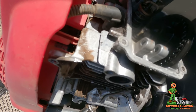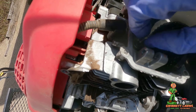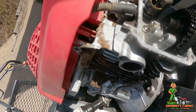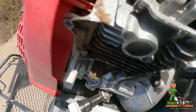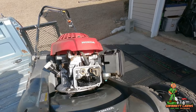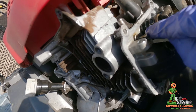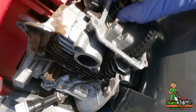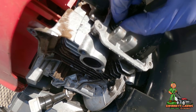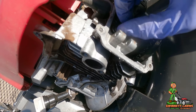Make sure the engine is at top dead center, because if the piston is at the bottom of the cylinder the valve could fall down in there. That's pretty good right there. I'm just going to have to make this part of my routine. I've heard there is a fix where you can take the intake umbrella seal and put it on this one and it will prevent it from coming out, but I'm not sure about that. It's just a bad design.